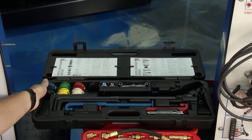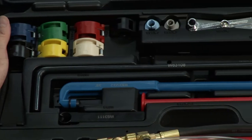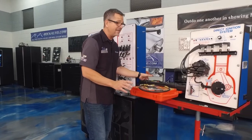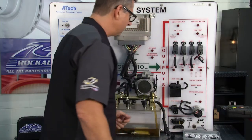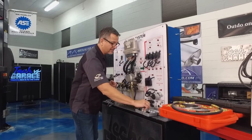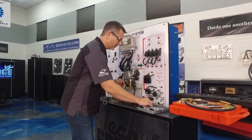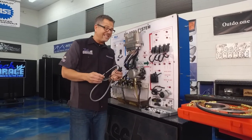When it comes to taking off lines, this kit has everything — from fuel lines to heater hoses to different air conditioning lines and all the quick disconnects that we end up breaking when we try to pry them off. You'll wish you had that set. For fuel injection, the noid lights — when you're checking injector pulses, you want to use one of these. Noid lights have a little resistance in them so they don't mess with the system. Put it in, it pulses, and you know your computer's working. And don't forget good old faithful — a stethoscope, inexpensive and invaluable.